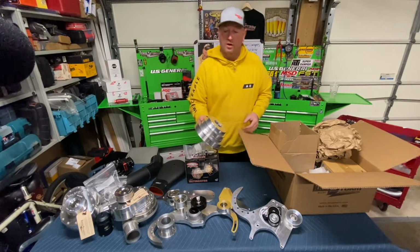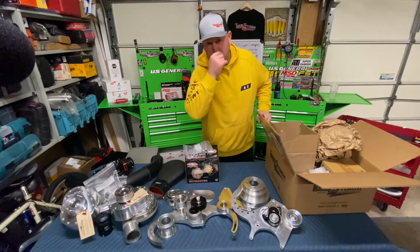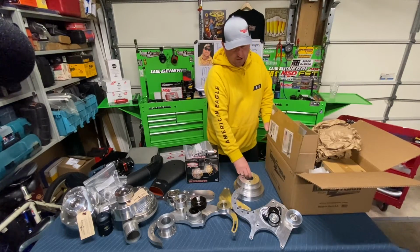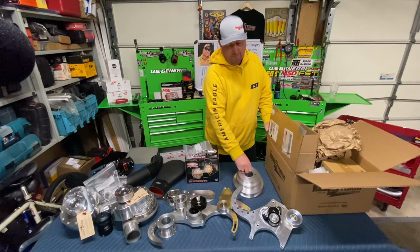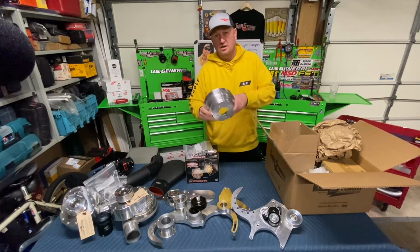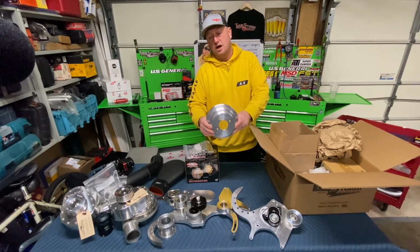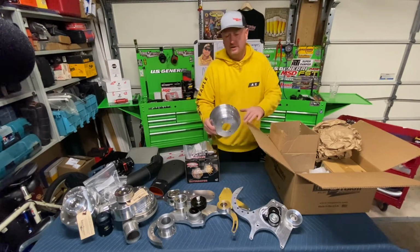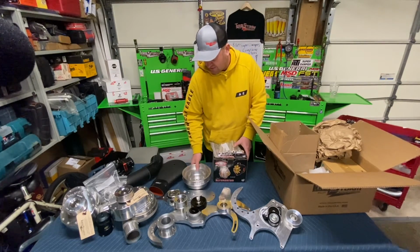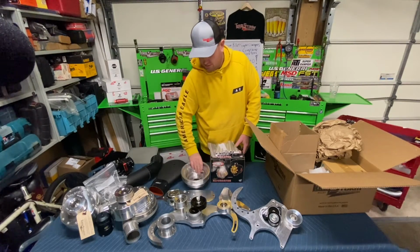Oh, and one thing to note, on these older Ford engines, you don't need to drill and pin the crank. I know that comes up on some of these other engines where you actually have to do it, but on my engine there is no need to do that. I just basically take my pulley off, and this attaches right to the damper that's on the end of the crank right now. So again, just a really nice piece right there. Some more automotive jewelry to look at.